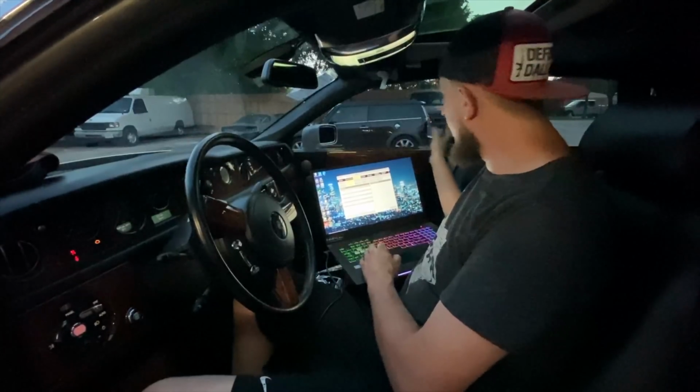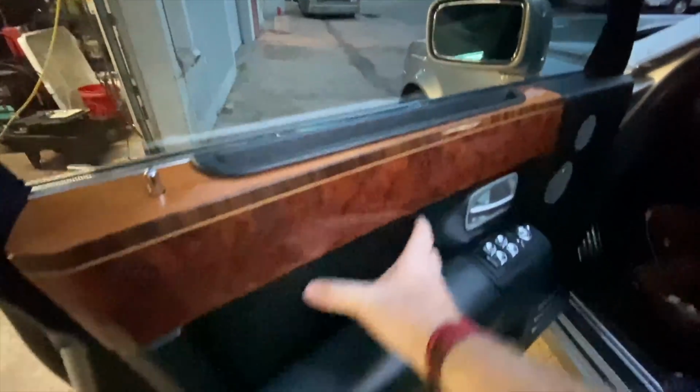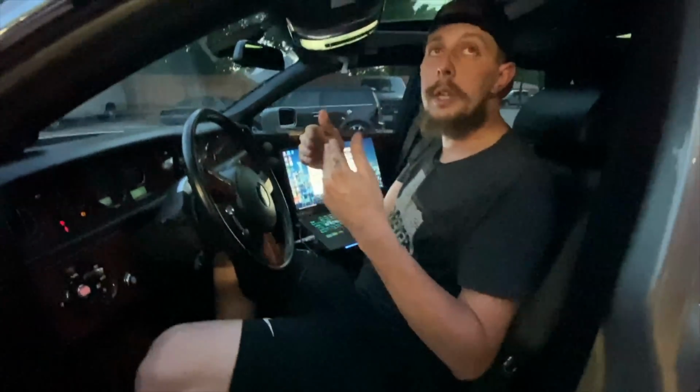And what's up with those? It's coming from the door. So it's the same door problem? Right, the door bags, because these are airbags inside the door. When it's not seeing that body control module, it can't communicate. Of course, the airbag has its own airbag module as well. So it's probably related. When it's losing its connection to that door module, it's firing up to the airbag. It connects into the airbag.